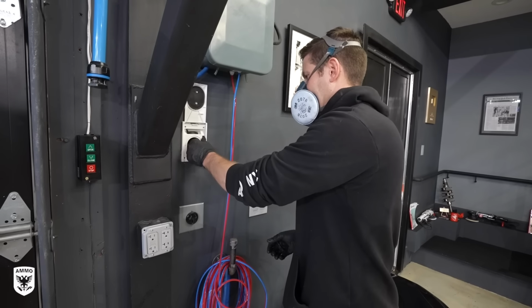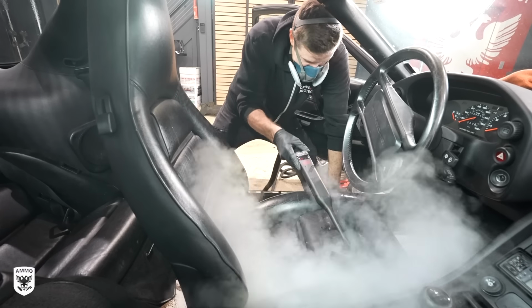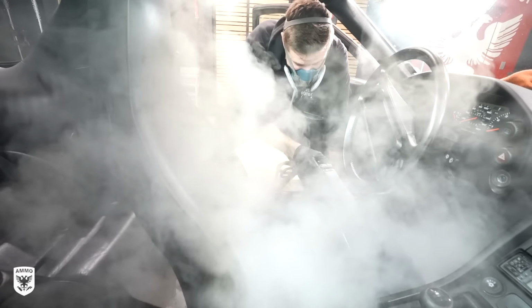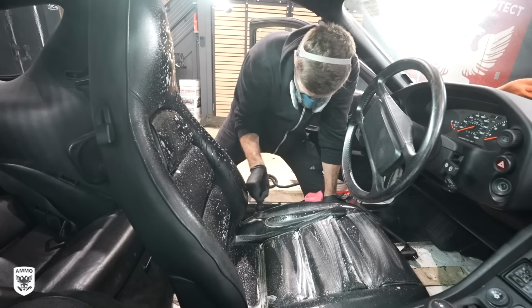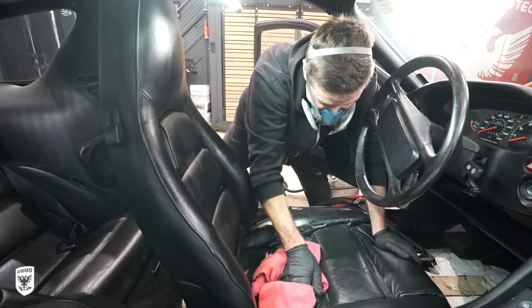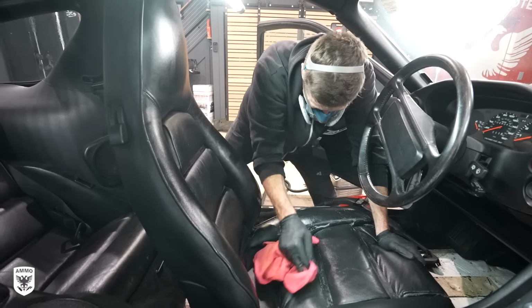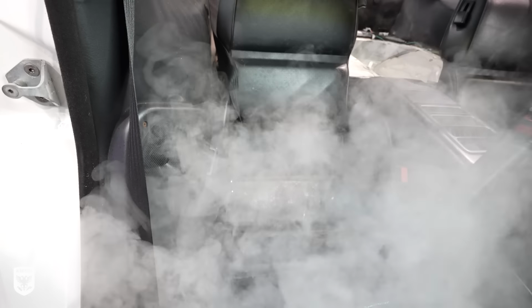My specific technique on this interior was to first quickly heat up the seat with steam, spray lather, then agitate with my interior dual density small brush, and then simply scoop it up with a microfiber towel. As you can see, I didn't use the steam and the lather together because the seats were just not as bad as the oily GMC truck that required more strength to clean it. My point is this, use only what is needed and no more. Less is more during a preservation detail.